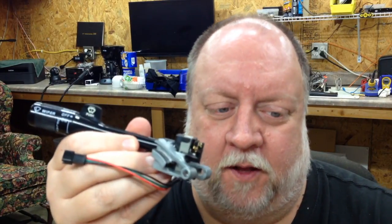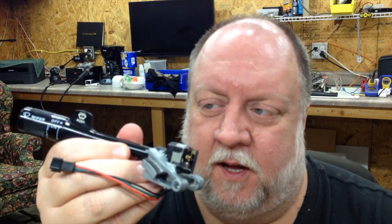I had already ordered a replacement before I did the research and found out it was more trouble than I wanted. But I got to looking at it and there are only three or four electrical connections. I'm an electronics guy, so I got to thinking — it's a switch, turns it on, turns it off, pulses the washer, and has a five-step delay. I said, this is nothing but resistance and a switch, so I should be able to make my own module to interface with this wiring harness. That's what I did, and that's what this video is all about.